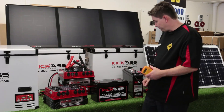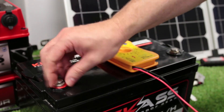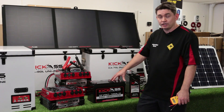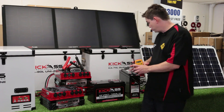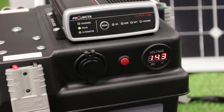One of the very first things you should check with your battery is make sure all the connections and where you've got it connected to are clean and tight — that's very important. The next thing, and probably the most important thing, is to check the voltage of the battery. You can do that with a multimeter or with an inbuilt voltage meter in your battery pack if you've got one.